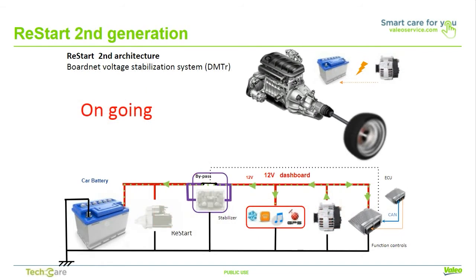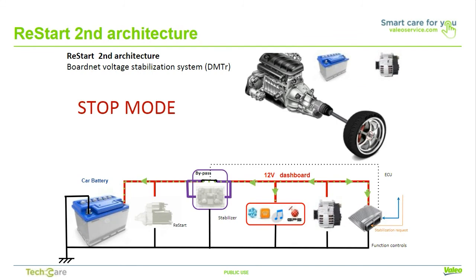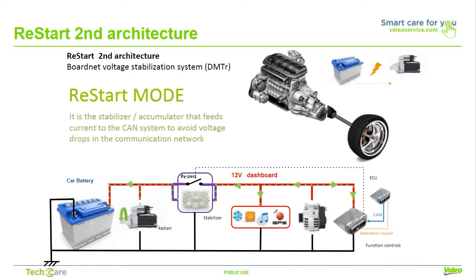In the second-generation restart architecture, the system remains the same as the standard vehicle setup with the alternator supplying power to the battery and vehicle functions. The difference is that the engine control unit is separate from the board network. During the stop phase, the car battery supplies energy to the board network and ECUs. An embedded stabilized system with a voltage regulator with a functional operating supply voltage between 3.5 volts and 28 volts supplies and supports extended current capabilities up to 150 milliamps to optionally supply external components such as a CAN transceiver. At the restart phase, the stabilization function supplies current only to the car ECU on a dedicated network to maintain saved values of each engine sensor and to provide a quick start.